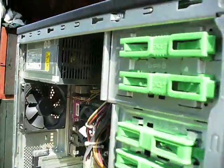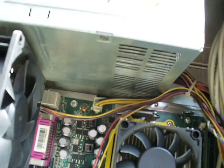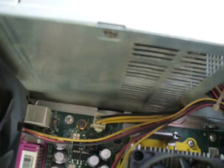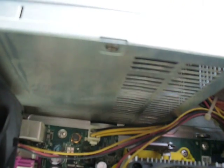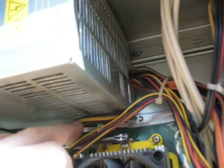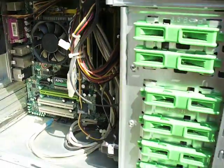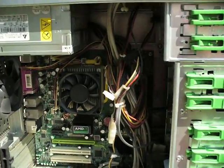So, Acer Desktop: if you can't get it to come out of hibernation or sleep mode, open up your side case and look for the PWR2 connector — yellow and black wires coming off the power supply, two yellow and two black. Unplug it, start it up, shut it down, plug it back in, then start it up again, and your problem — at least my problem — was fixed.